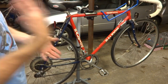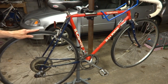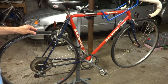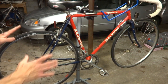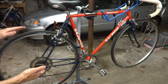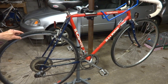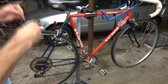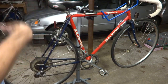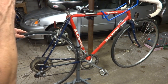Over a series of videos I'm going to upgrade this bike. The first upgrade is I'm going to swap out these 27-inch wheels and install 700C wheels, which are the more current wheels. 27-inch used to be the standard for sport bikes, but these days it's 700C. They're very similar in size — the 700C are just very slightly smaller in diameter. The advantage for 700C wheels is you're going to have a larger variety of tires available, and the newer wheels are skinnier, which is going to come into play in some of the upgrades in the future.